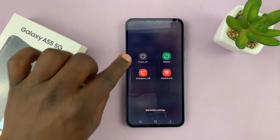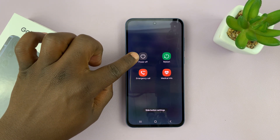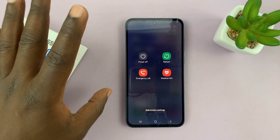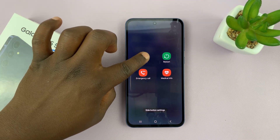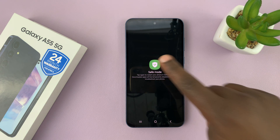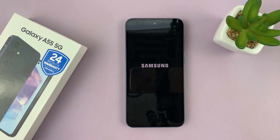So what you want to do now is long press the power button. If you tap on it once that's not going to work — you have to long press. Long press and that button turns into a safe mode button. Now when you tap on it, it's going to restart the phone and boot back up in safe mode.